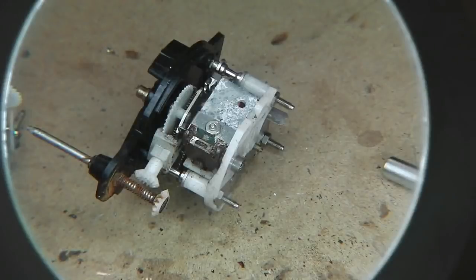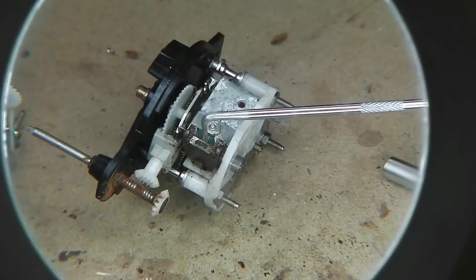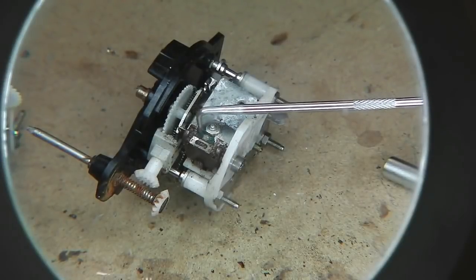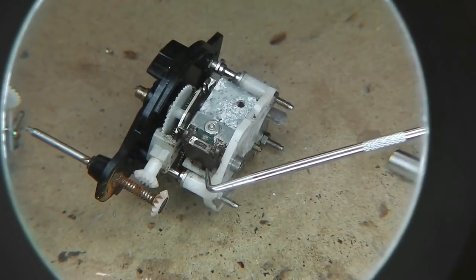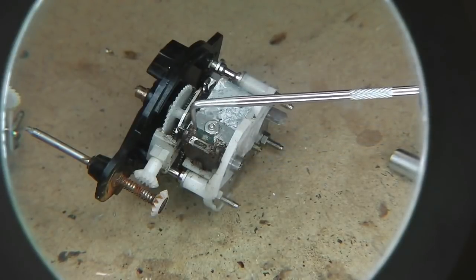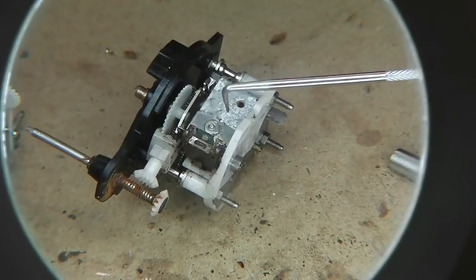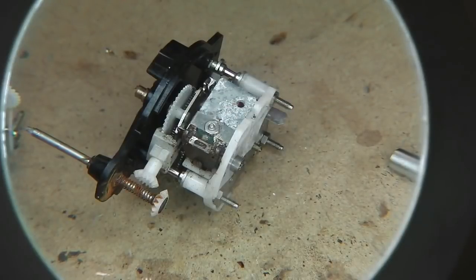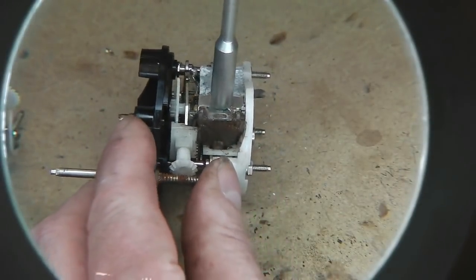Okay, we seem to have tracked down the fault on this. There's an armature just here. The solenoid armature is seized, and I think that between the coil windings and the actual armature flap itself, it's built up some crud and the lever won't energize and pull down. I've managed to just wiggle it free on the fulcrum point, but it's not compressing, it's not drawing itself into the solenoid. I think it's got a load of muck underneath the arm and it can't compress. It needs to be taken off, so we can probably get in just on this nut.